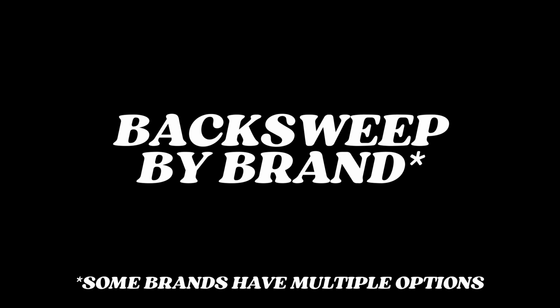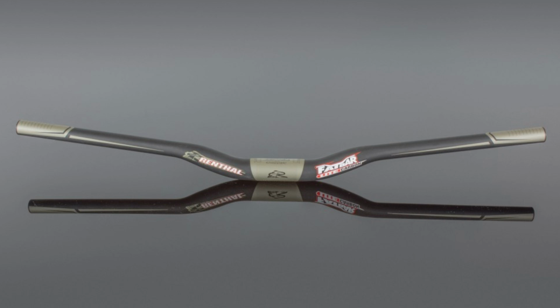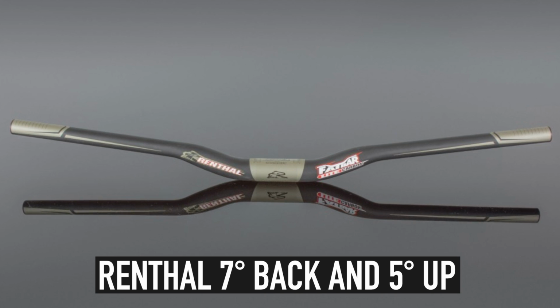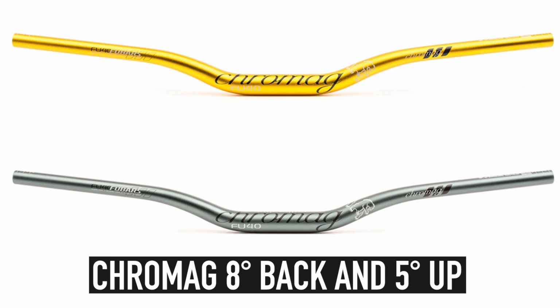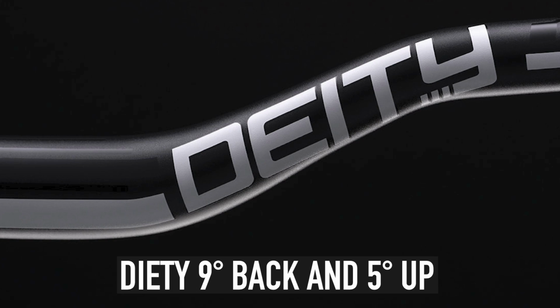Okay, so I made a little list, I'm gonna go through it right now, of different bars. Renthal Fatbar: 7-degree back, 5-degree up. OneUp makes an 8-degree back sweep and 5-degree up. Chromag is an 8-degree, 5-degree up. Deity is a 9-degree back sweep and a 5-degree up. A little much for me.